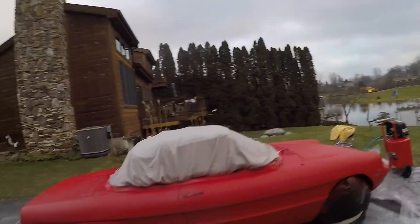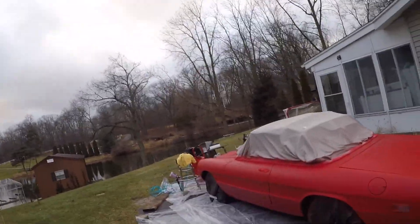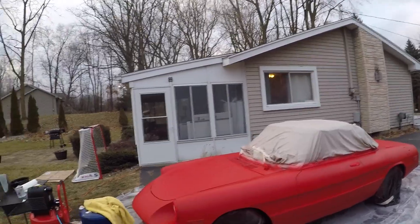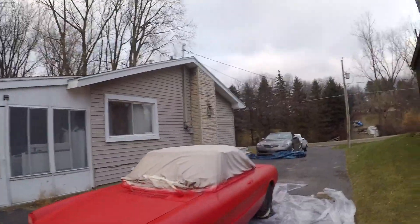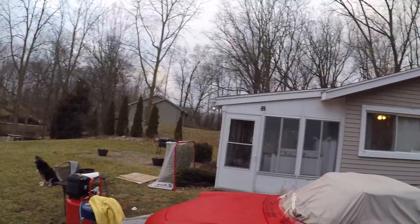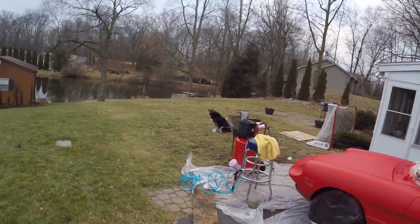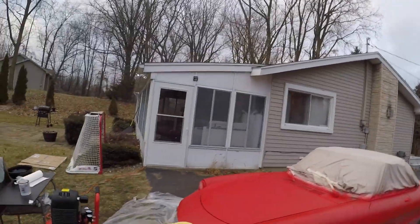Coat one is complete. It's on heavier in some places than others, but it's covered, and I love the color where it is on and covering heavy. I'm only going to wait about 10 minutes for this to dry before moving on to coat number two, because I've only got about an hour of daylight left and I really want to get clear coat on today as well — but that doesn't seem likely. Really happy with the gun and the air compressor — both seem to be working well. My biggest issue was my own fault: I didn't use the perfect towel for the final wipe-down of the car. I didn't have a tack towel, so I used a microfiber which had some stuff in it, and I'm now seeing that on the hood and the trunk. I'm hoping it's just sitting on there so when the paint dries I can flick it off. I did find one hair as well, so I'm going to try and remove that — but overall really happy with the first coat.